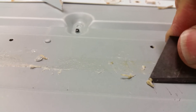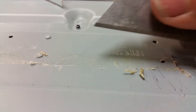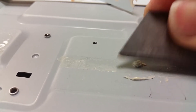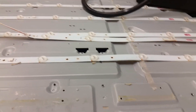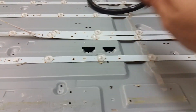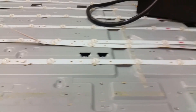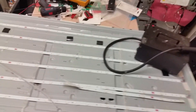If you have removed LED strips before, you know that most of the time when strips are bad, this glue has already hardened and is easy to remove. Well, not this time — it is going to be a real pain. Considering all the problems, all the time it will take to put the screws back, all the time to remove the strips and clean underneath — because the alternative is just to do a nasty job and tape on top without caring — why bother if something underneath is making the strip warp and not contact fully on the back panel to dissipate the heat?